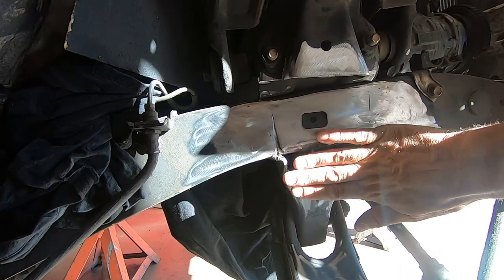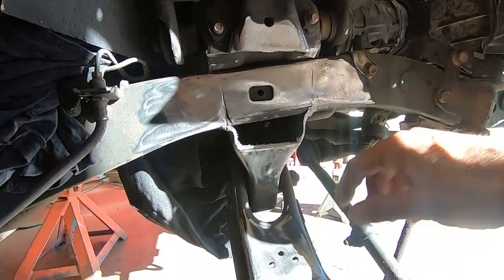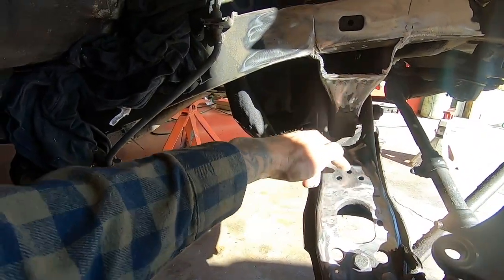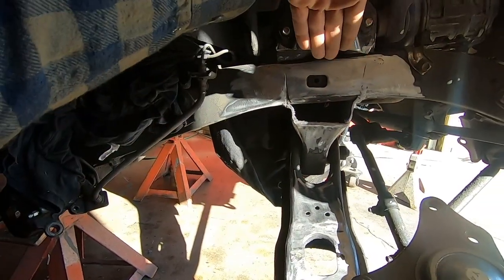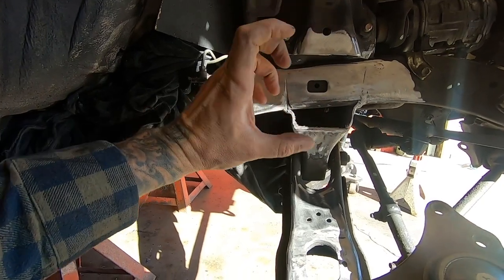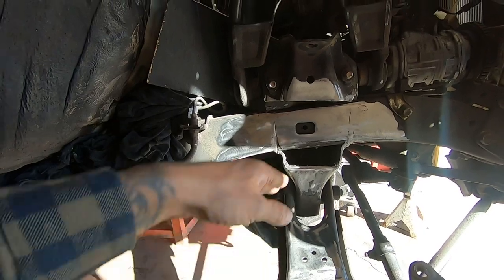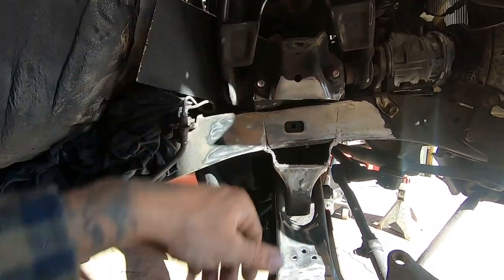We'll get this guy plated in and reinforced, and then I'll go ahead and get some bag brackets going in here. Lower mount is just gonna be figuring out the position, get a couple of tacks on it, make sure we like it. Upper mount, we're gonna have to match the same angle as the bottom, get that in. Do our squish test of around 3 inches because your bag collapsed is around 3 inches. So we want that set the same as the bottom. Nice spacing, get the bolts in.